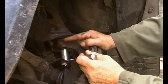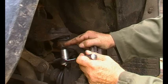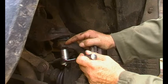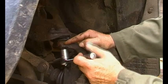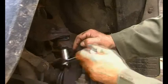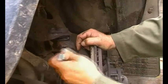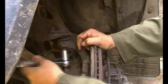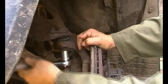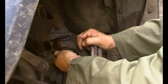You've got to be careful here because that's the ball joint - it sits in here on the taper. If you do too much battering about you can loosen the taper, and then there's nothing to stop the threaded section from twizzling around. So clean everything off, soak everything, and then perhaps it's not quite so difficult.